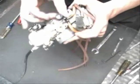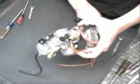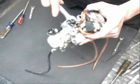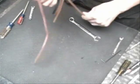Next, we're going to put the choke knob back into the carburetor. Just feed that in there. Run it down with your fingers, and a 14mm wrench. Snug it down. Again, this thing's plastic, so you don't want to over tighten it. You'll strip it out. Carburetor's back together, and we're ready to put it back on the bike.